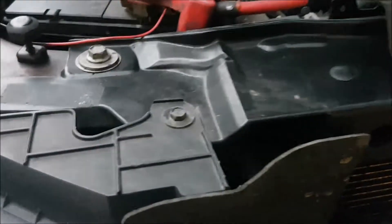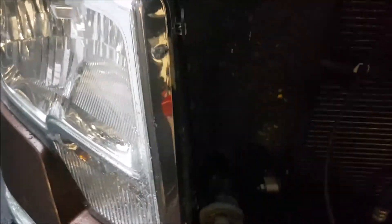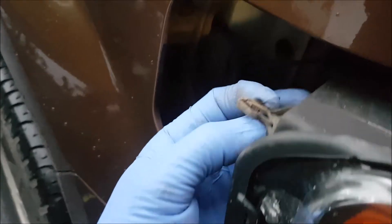So we're going to need to take out two screws off the top for the headlights, because we can't get a hand in behind the battery. Then there's another bolt in behind here, behind your little flap — the wind deflector. You're going to need a 10 mil. We've got our two off the top, we've got our one from underneath. Then if you come around this side, there's a tab here.